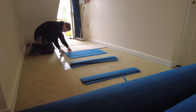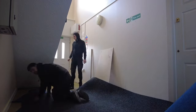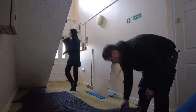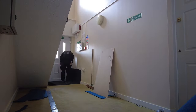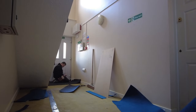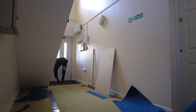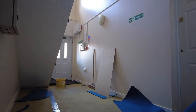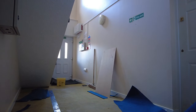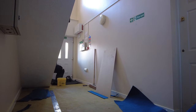Now I'm pulling in the piece of matting that's going to go in the front door, cutting that piece off on the width so you can lay off the front of the door. It gives me a nice straight edge to fit the carpet up to because I'm not going to put a bar on it — it's going to actually fit up to one of the lower ridges in the matting.